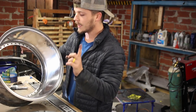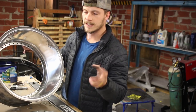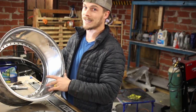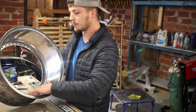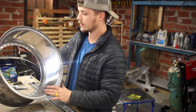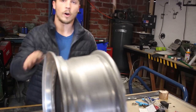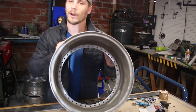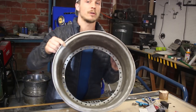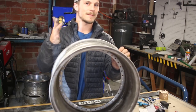What I did on this one that was a mistake is I used a flap wheel instead of a strip wheel. The difference is the strip wheel has a real rough kind of grip and it doesn't really bite into the metal, whereas the flap wheel bites into the metal pretty aggressively. So there's some blemishes in the metal that I created with the flap wheel — flap wheel is not the way to go, strip wheel is. I now have a process that I think is going to be really good for restoring rough old aluminum like this in your garage without any special tools. You do need a buffer. That's basically it.